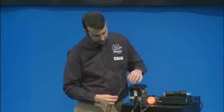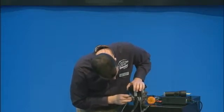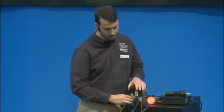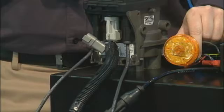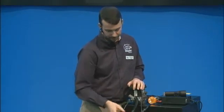Now here's an additional piece that we included. If you now leave power on on the unit and you fix the problem — I'm going to fix it simply by plugging the sensor back in — and I'm not going to power down this time. You notice also, while I'm connected here with this little unit, the lamp, instead of doing the blink code once, continuously keeps repeating the blinking pattern, saying you have a problem. So you can double-check through the trailer lamp that this unit is calling out the right information.